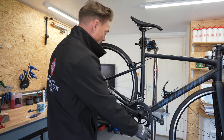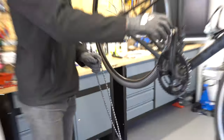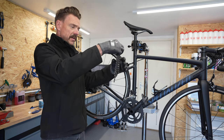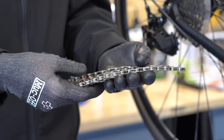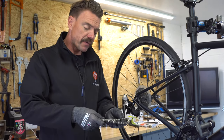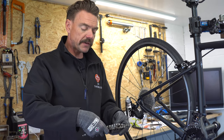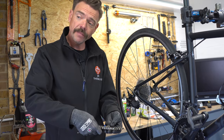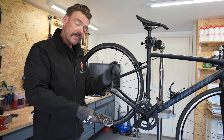I'm just going to unwind the chain gently from the system — and I'm afraid this one's lived its best life, but now it's time to give it a funeral. This here is its replacement, shiny and clean. Do remember to buy yourself the right type of chain. I know it sounds obvious, but I've seen quite a few bikes where the owner didn't pay attention to the fact their bike is 11 speed and bought a 10 speed chain. They're all different thicknesses, so they are all different.